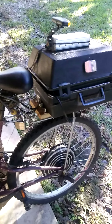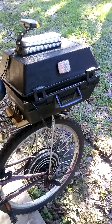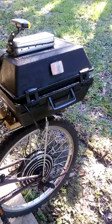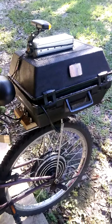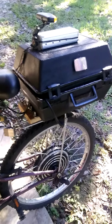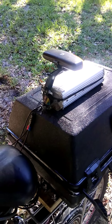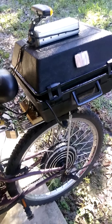That kind of battery pack is a lot lighter, not very difficult to make, and you actually get a lot more amp hours out of it than you would with lead acid batteries. For anyone wondering what amp hours are — the more amp hours you have, the longer you can go before running out of power. Amp hours are your battery capacity, not the output; the voltage and wattage are your output. I have to stick with 1000 watts and 48 volts, but I can increase the amp hours as high as I want.